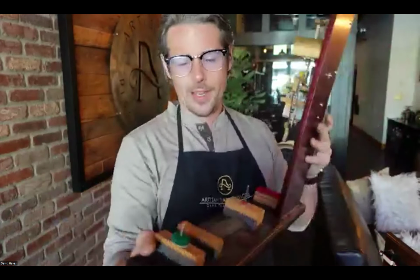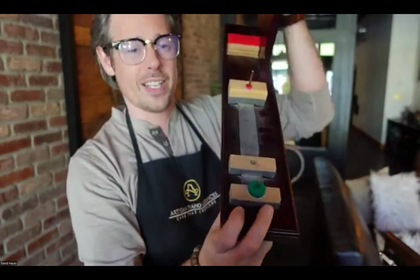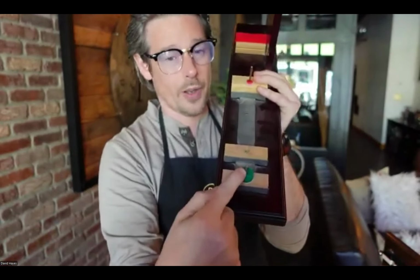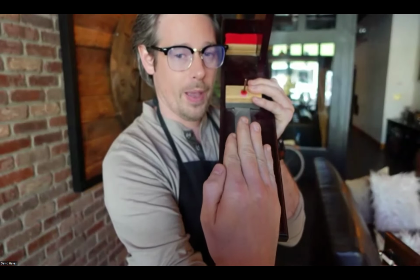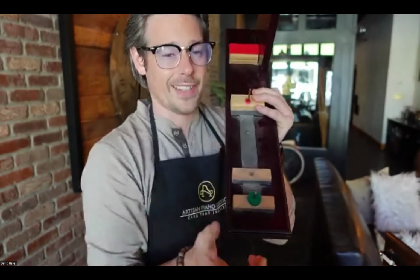What you can do in a situation where the customer doesn't want to pay any money, it's kind of a band-aid fix. And right here, you have that front rail pin, and it's oval shaped. So if you wanted to, you can go ahead and pivot that pin ever so slightly, just like my hand. This is like the top view of that pin. If you pivot it a little bit, it takes up more of that space inside that key. That's not a great long-term fix, but that's definitely a fix that you can do.